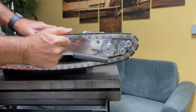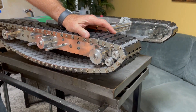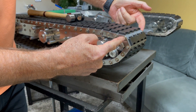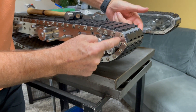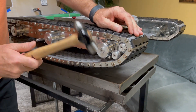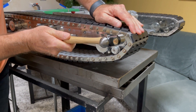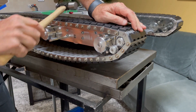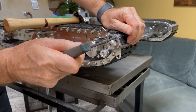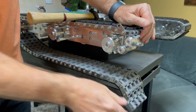You can see the track is now loose — that's what you want. Now I'm going to remove the little rotoclip. I want to make sure that the pin I'm removing is being supported by the very front sprocket, so it's got to be all the way up front. I'm going to tap it a couple of times until that clip falls off. There it fell off. Now the pin is exposed and I can push it all the way out with my Allen wrench. Now the track is loose and ready to take off.